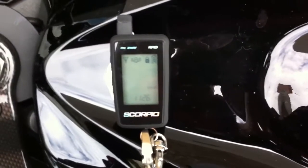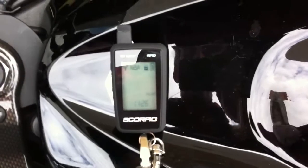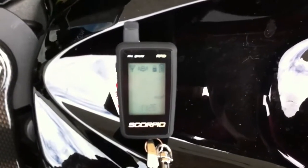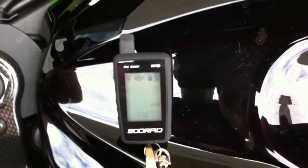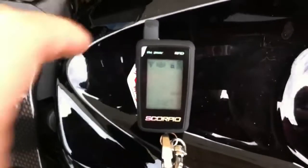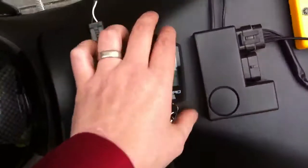I also notice at this point it's getting 'perimeter off' whether the module's plugged in or not. Despite the perimeter module actually being set to auto-on, it still decides to turn itself off all the time. The only way I can get the perimeter module to automatically activate is if I put the key fob right next to the MCN.